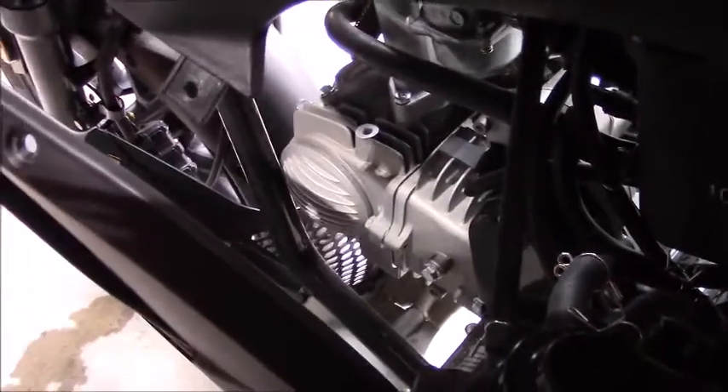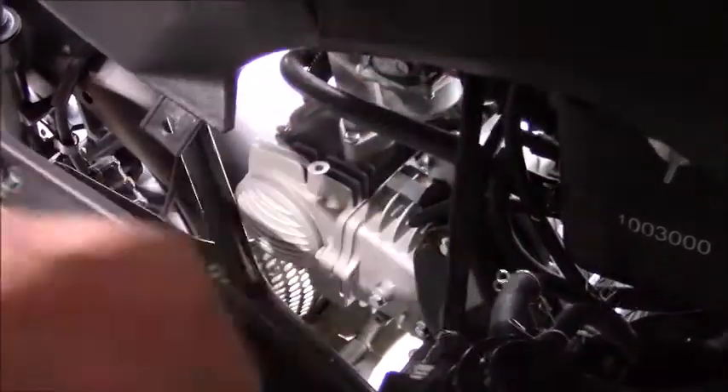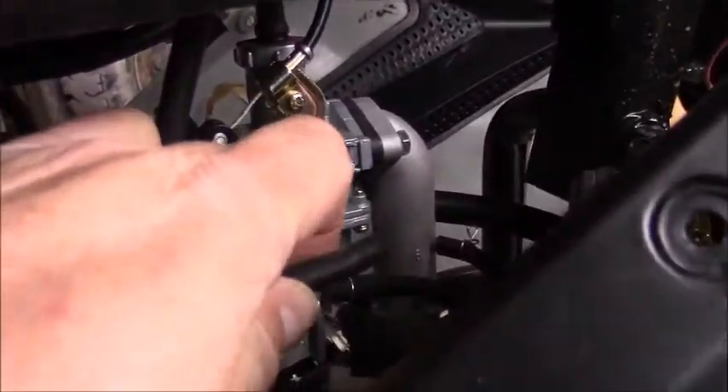In the old days I would have said just get yourself a new gas cap, but these days no — you should never have to do that. What you're looking for are restrictions or kinks in the EVAP system on your bike. Get those squared off and your bike will purr perfectly. When we look at the carburetor, this is the line that is producing the negative pressure from the carburetor for the EVAP system — and there's nothing wrong here. The problem typically occurs up here: in this area we have the frame, a variety of wires, and this suction line from the carburetor to the EVAP system. Typically what will occur is that a zip tie is used in this area, and if it's zipped up a little too tightly that's where you're going to get a restriction to flow. As soon as that happens you're going to have the funny idle conditions.